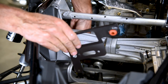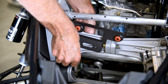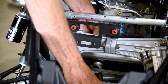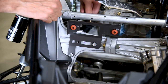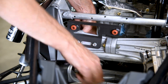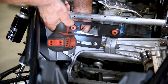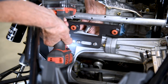Using the three holes that originally held the exhaust valve servo onto the bulkhead, install the provided SLP pipe support bracket. Use the two supplied 6x1x20mm bolts in the upper holes and one supplied 6x1x16mm bolt in the lower hole, along with the supplied 6x1mm nylock nuts. At this point, if you've also purchased an SLP torque arm, this is where you should install that — see the specific installation instructions for the SLP torque arm to complete this process.